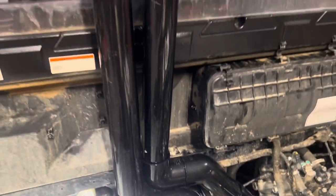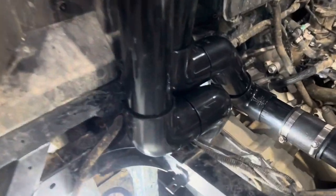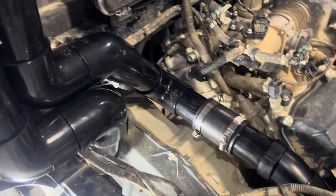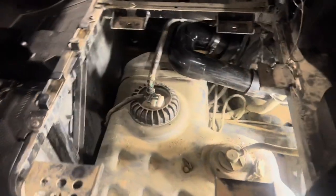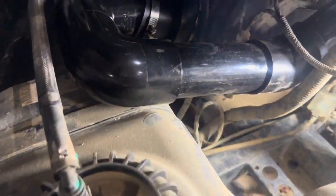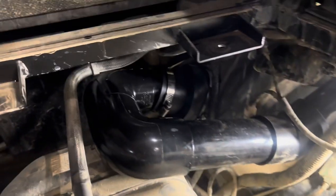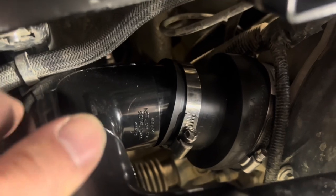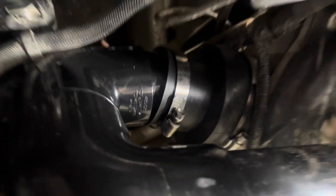But this is kind of it. Obviously you've got to glue all the PVC connections together, so you take everything back out and glue all the joints. The only thing that doesn't get glued is the rubber boots — they tell you to put silicone on those when you do the final tightening. Here's the 90-degree angle going back, two 90s, and again there's that boot. I think a specialized boot would probably be better for this, but I guess it works.